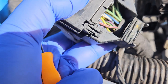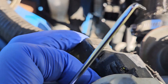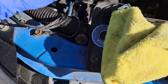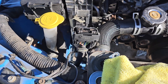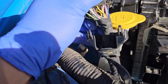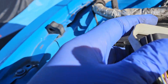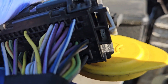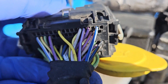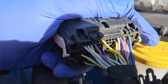You can see these two tabs — one there, one there. They're on the front too. You're going to disconnect all four of those tabs so that the head of this connector comes off. With that removed, it just has a little tape around it — you can slide it down the harness. The back side of this connector is labeled. You can see 17, 33, 50, and so on. So again, you're going to want to find pin 41, which is the blue wire.